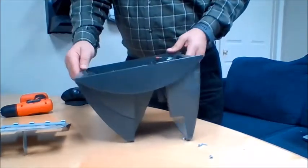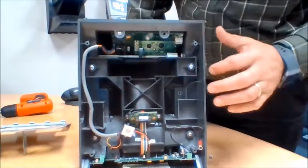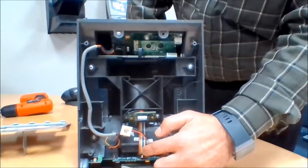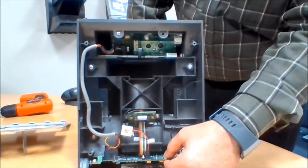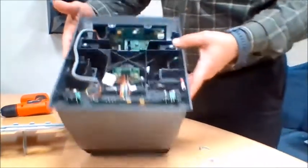Once you have the back plate off, there are 3 screws to take off, right here, and directly under the ribbon cable here. There will be a silver screw just on the other side of this ribbon cable. The motherboard can slip out, so you can actually get more room to take that screw out. That's the next thing I would do.